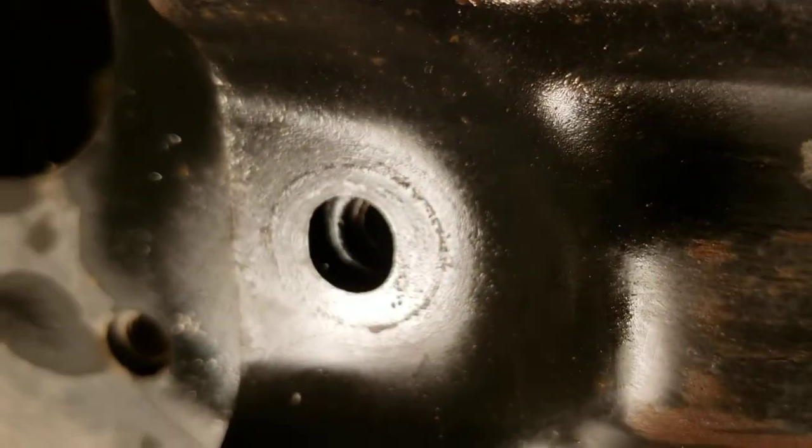Here we are underneath a 2019 Toyota Hilux. An oil change first requires removal of this protector plate. There are six bolts that you have to take off — nobody else talks about that as part of the oil change process. When this plate comes off, I recommend putting some WD-40 on the bolts.